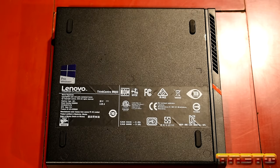There we go. The heatsink has been reinstalled. Hopefully, I did everything right. So now we are going to install that cover back on. So it goes like this. It'll go like that. It just snaps on, I believe. We'll put the speaker back in, try to reconnect it. I'm also going to remove this extra DisplayPort connector because I will be having a serial port coming later. So we'll get that out of there.